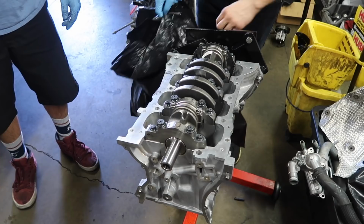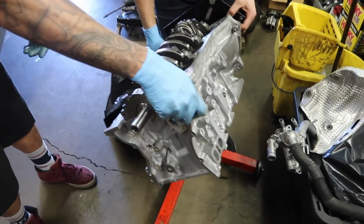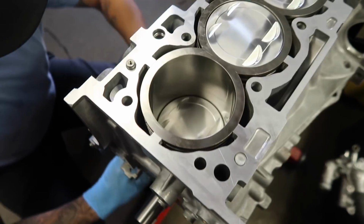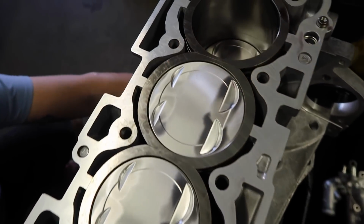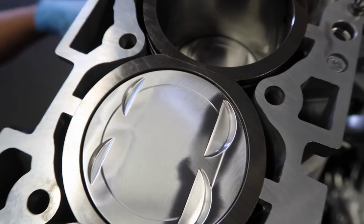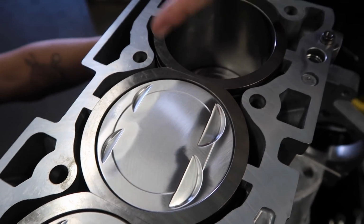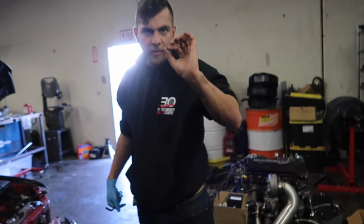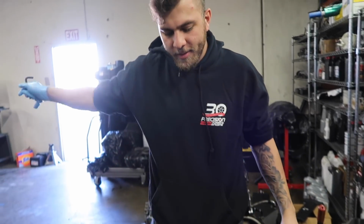I want to turn it around, but it's gonna drip everywhere because I have a sanding. You see how these are sanded? You see that, right? Can they see it? See how the color is... Yeah, you can see it. The reason they do that is because this piston has sharp edges, and if you don't do that, it'll detonate. It'll be a hot spot. It's a very concentrated, pointy surface. Right, I did that on mine too.